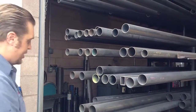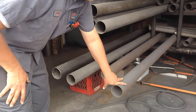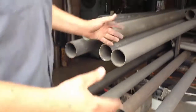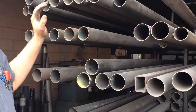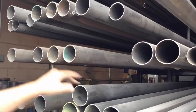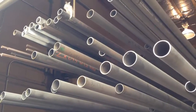Again, like I said, we make stuff for semi-trucks. That would be the larger heavy wall, 134 thousandths wall thickness, 4-inch tubing. The most common stuff that you're going to see in over-the-road, passenger cars and light-duty trucks, anywhere from 2.5 to about 3.5-inch steel tubing. The smaller stuff would be for PTOs, some front drive shafts, like Jeeps.